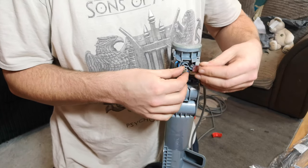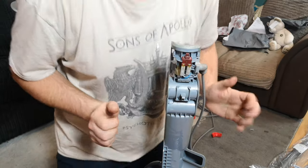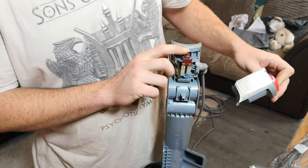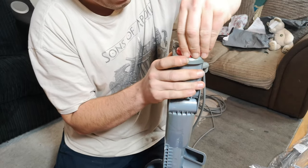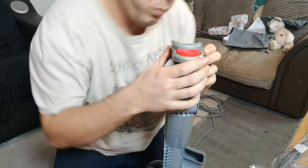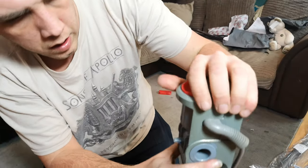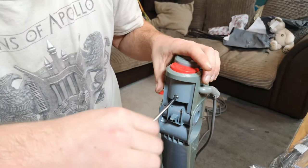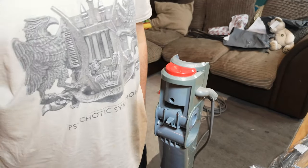Take the switch, plug in both live cables, make sure everything is out of the way where it should be. Turn the switch on because it drops it down — hold up the button and very carefully, being mindful not to damage the top of the spine which isn't very strong without this part, manoeuvre it into place and click it down. Once clipped down, take a screw and stick it in the front — this will put it all together. Check the switch still clicks and works.